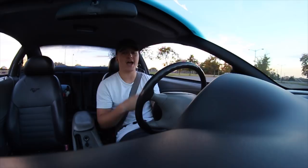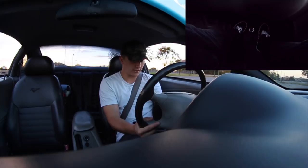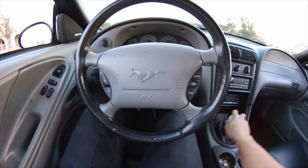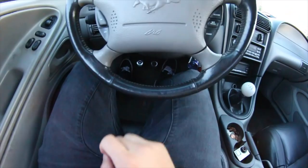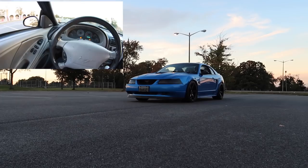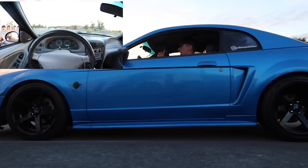Take a look. We have our clutch pushed in, I've got my right foot on the brake. I'm going to release my right foot off the brake, let go of the clutch really smooth, give it gas — let go, follow through — and as you guys can see, we're now moving. Now I'm going to show you guys from a driver's POV. We've got the car in neutral — you can tell it's neutral because you can shift the shifter left to right. We're going to put our right foot on the brake, left foot goes on the clutch, push it in, take our gear shifter, put it in first, and now from here we're going to look for that sweet spot with the clutch foot. We're going to start to move, give it some gas, keep following through, completely release — and as you can see, we are now moving.